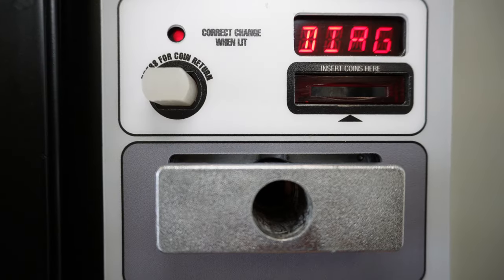We should get back to just two on the display. SP lets us see visually which circuits are being completed. So if you look at all your selections and you've got product in there and then go to SP, those numbers should be represented. If they're not, then you know which column or selection definitely has an uncompleted circuit, and you want to check your switch or check your wiring.